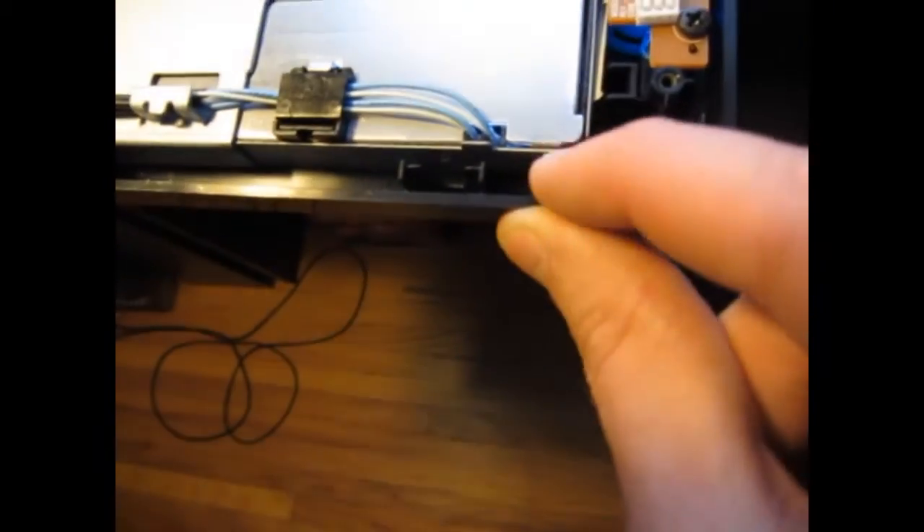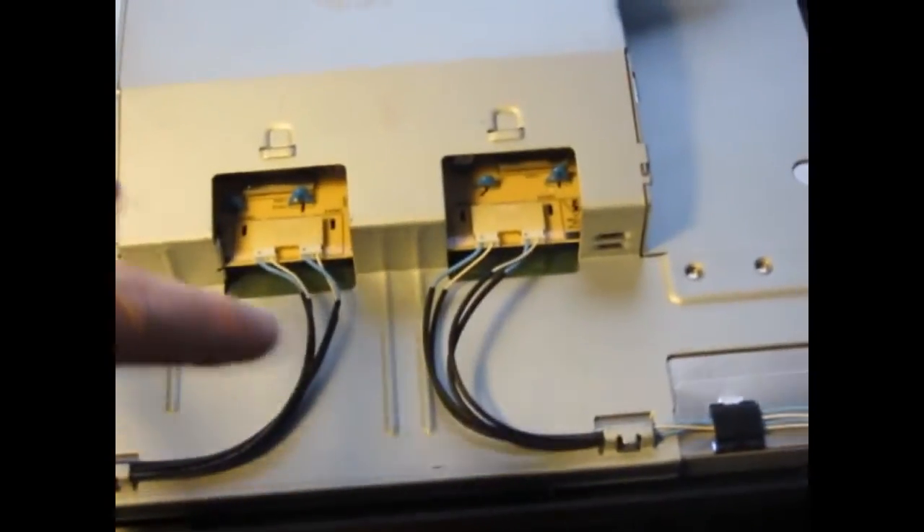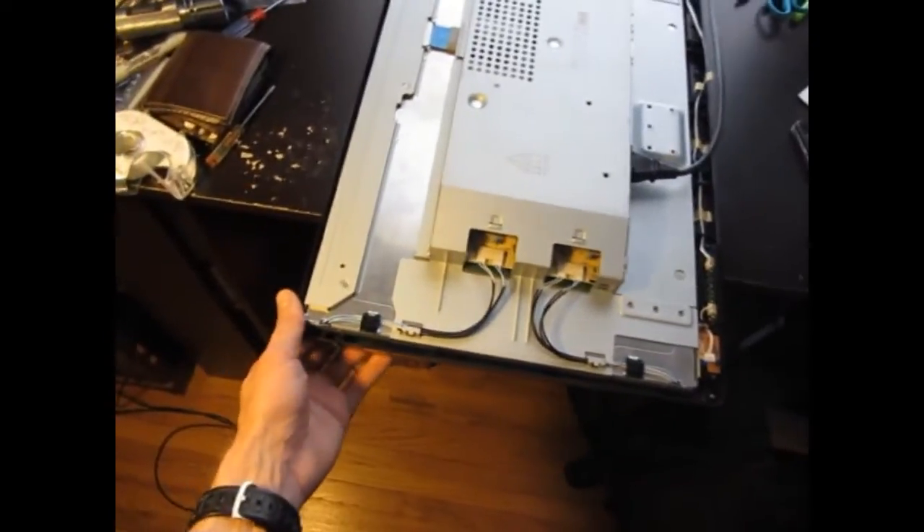To split these apart, you can see there's like a tab of metal. Just like how on this one the LCD screen fits into the plastic front bezel, a similar idea is used to hold all the parts of the actual panel together. We've got this front bezel — a metal piece only about this thick that goes all the way around — and that holds in the actual liquid crystal display. You take off that front bezel on this model, and then you have another plastic bezel that goes all the way around.